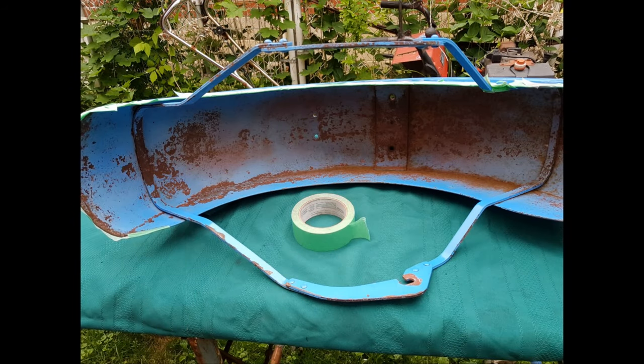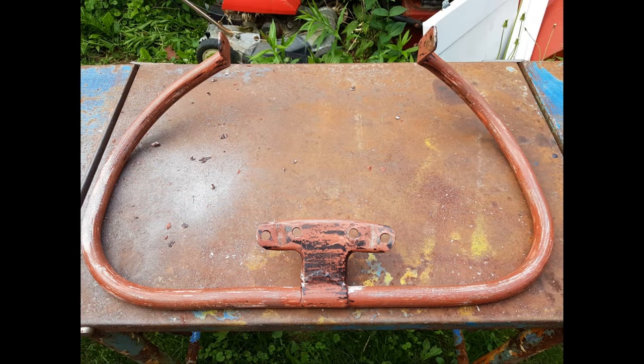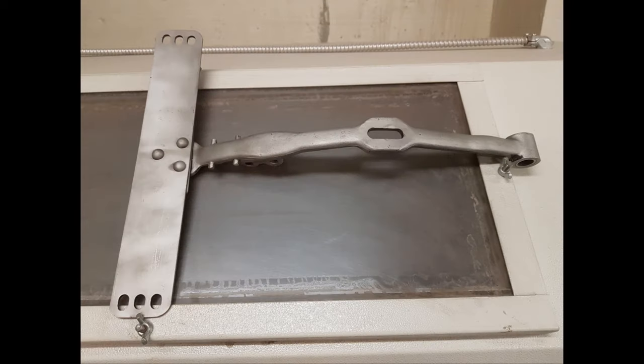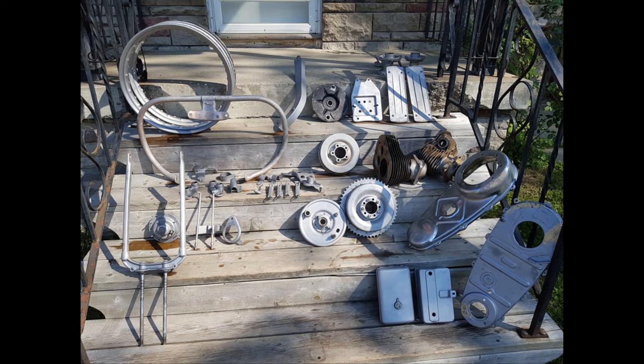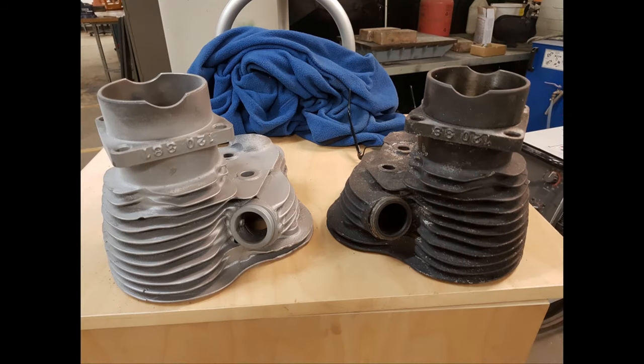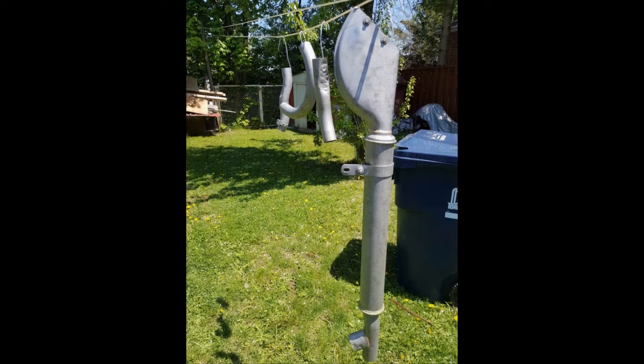You can see the fenders have rust inside on the inner part, so I'm getting those ready to take to his place along with the crash bar. I sandblasted everything that needed to be sandblasted, did all the repairs before painting. Here's a bunch of parts I just finished washing, getting them ready for priming — the springer cylinders, the exhaust. Really happy, no damage to those.